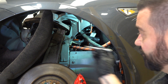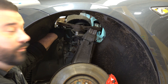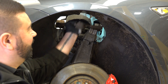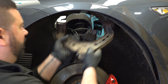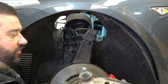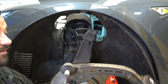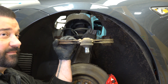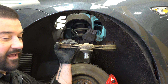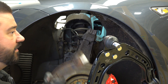The bolt goes straight through the arm and into the captive nut. We've levered top and bottom just to get it clear, and then we can pull that arm clear. You can see all the corrosion on this old arm, and again as we were saying, sometimes this bush becomes detached because of its orientation — the grease is always falling to the bottom, which can cause it to wear a little bit quicker. We're now going to replace it with the Delphi arm and fit it straight on.